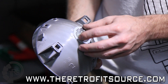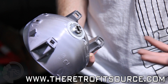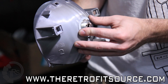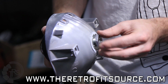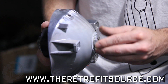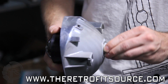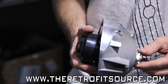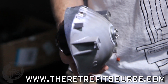And from there, put the adapter plate on. This is an H7 adapter plate. For the purpose of this retrofit, it's really just serving for extra support on the reflector to give it a little more surface area. We've got that on there on the back and then we'll go ahead and thread on our hex lock ring. We want to be careful when doing this because the threads are a little bit soft and when you tighten them down all the way, they're made to deform so that it locks itself in place permanently. Just hand tighten it at first because you're probably going to need to adjust the rotation of the projector after the fact, since we're not using adapter plates that set that rotation automatically, like an H4 or H7 based application.